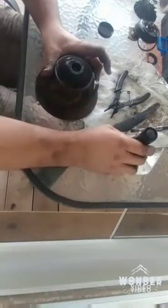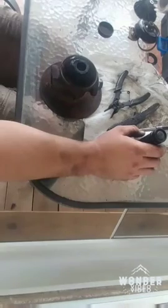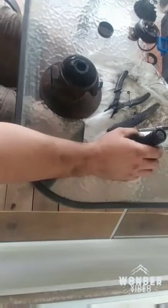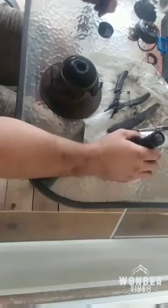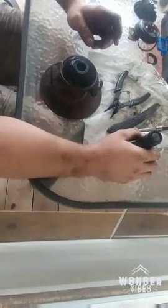That's how you replace the bearings and thrust washer on one of these turbos. I wish I could have found a 360-degree thrust bearing because that helps when you're compounding, but I couldn't find one. The kit I got to rebuild this was on Amazon - just typed in 'HX35 rebuild kit' and the first one that popped up is what I got; it was about $40 and arrived next day. To replace the exhaust side ring, use a flat head screwdriver or snap ring pliers to press it off, then slide the new one on - be careful not to break it.